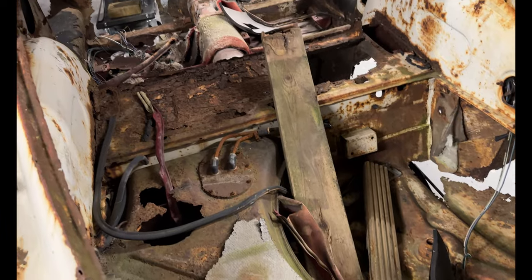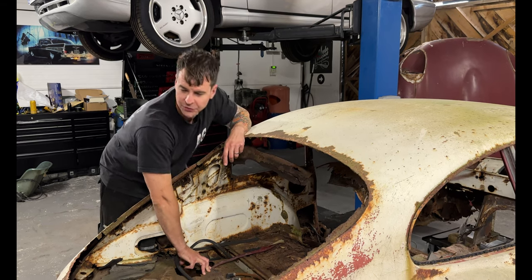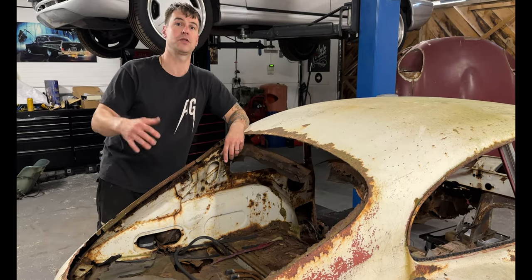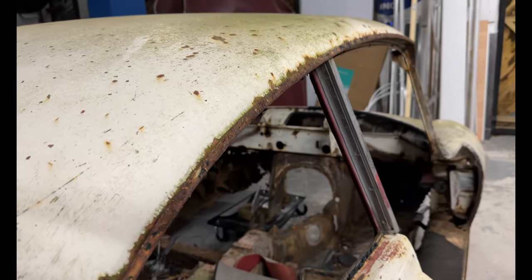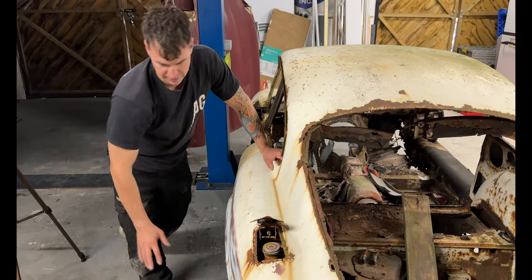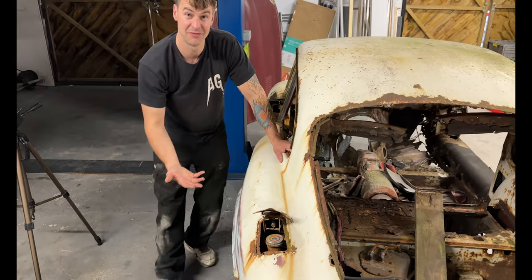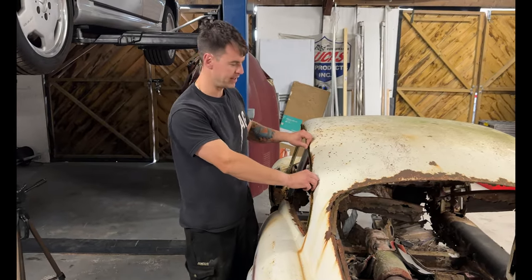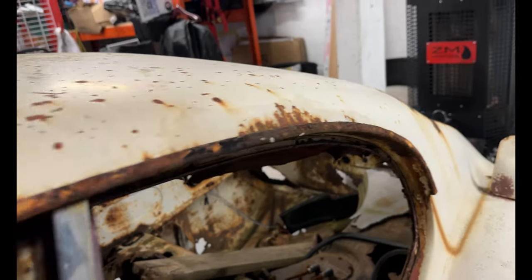This fuel tank is amazing how it's rotted away - there's a huge hole right in the top and I don't even know how it would have happened. There's more panelling to do around the back, but a lot of it I'm cutting out anyway. The fuel filler cap area is all rotted away, but I'm cutting all of this out, welding it up and getting rid of it. There are a couple of holes I'll be plating. Roof gutters - I love to hate them - I'll be flushing all of them off, which is something I did on the Mustang and absolutely loved the finish.